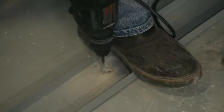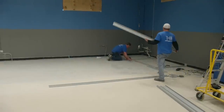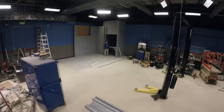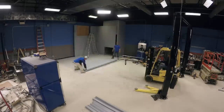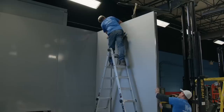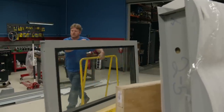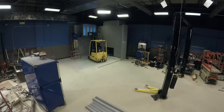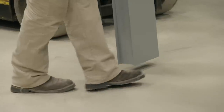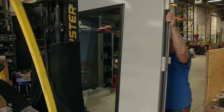Once you receive your test cell, you're going to uncrate it and start with your floor and foundation. Once you have the floor channel down — which is already pre-cut — all products and materials are pre-cut and pre-assembled where they can be. You level up your floor track and then start construction with the panels. It's a good modular package where we give you a full set of design drawings, and prior to creating your test cell, you actually get to approve it. With the track installed and leveled, the wall panels drop into position. They are only four inches thick but perform comparably to eight-inch thick concrete block filled with sand. The panels have an STC 50 rating — the sound level outside the dyno cell will be roughly 40 decibels quieter than inside during engine testing. The panels, doors, and walls are ballistic rated to protect operators and observers in case of major engine failure.